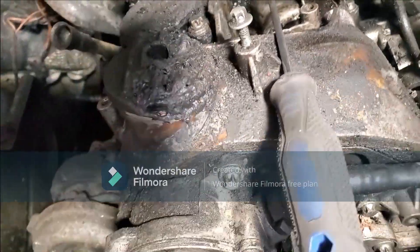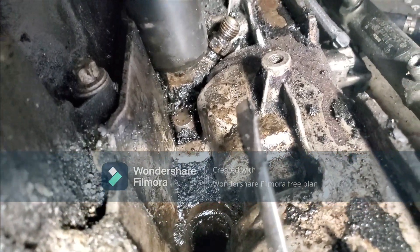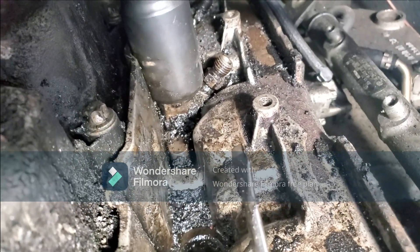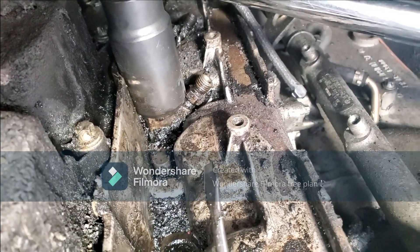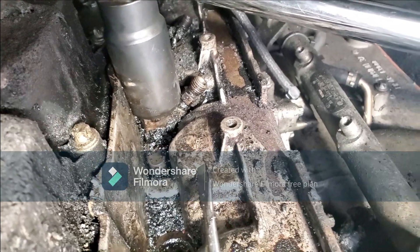Injector three has been pretty tough, but I think what might work is to get in there with a flathead and make sure you don't have any carbon buildup by the hold down. That hold down is what kind of starts the motion. If there's carbon on both sides and it can't move, that's hopefully most of the issue — and then I'll be able to get it loosened up enough to start pulling on it.